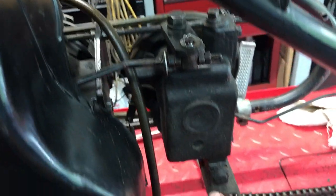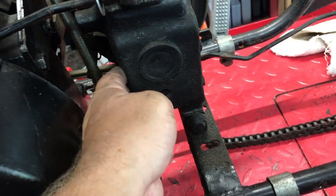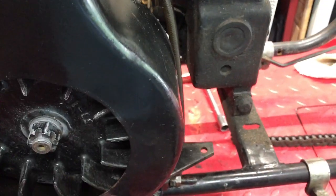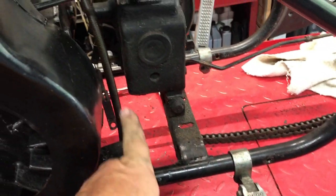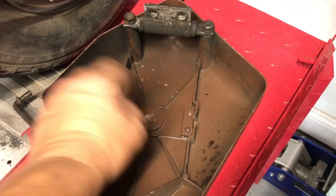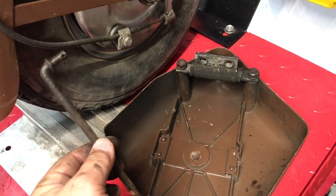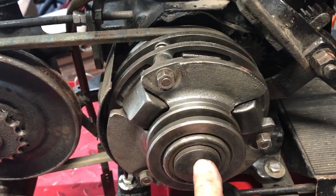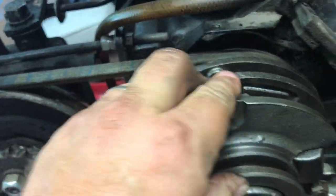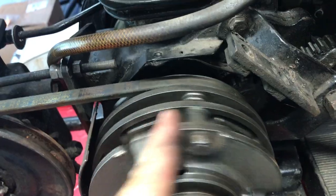I've got to pop this loose, get that adjustment loose — this pivots forward on that bolt, but this bolt is loose and the whole transmission is moving slightly, so we're gonna get that tightened up. Then we're gonna get the arm adjusted like it's supposed to. This is your clutch arm control, and we need to get that adjusted so that we have 3/8" clearance from the throw-out bearing. This here is your clutch arm mechanism — the throw-out bearing touches right there, this arm goes over and attaches, and it sits right here pushing against the throw-out bearing.